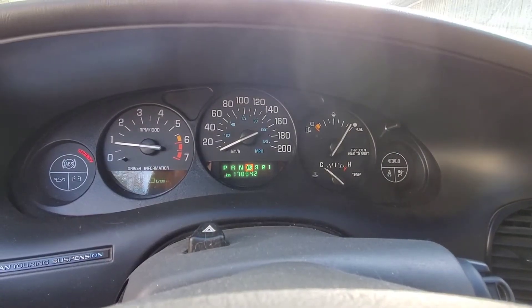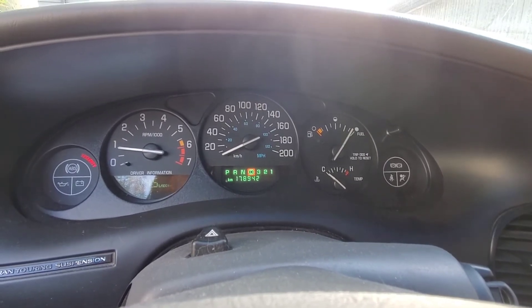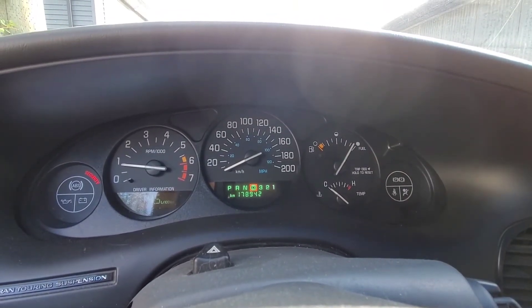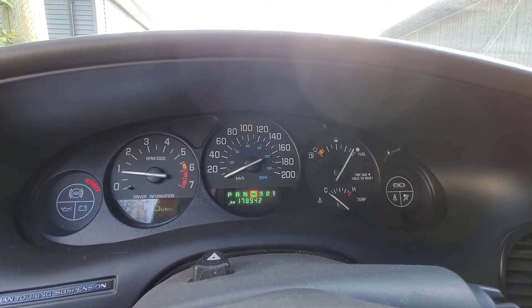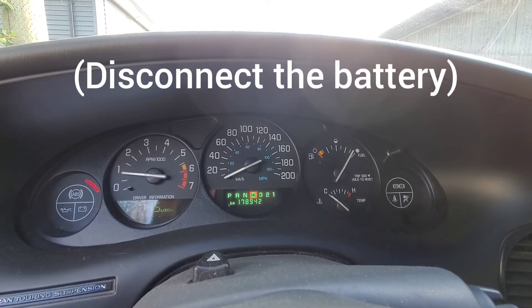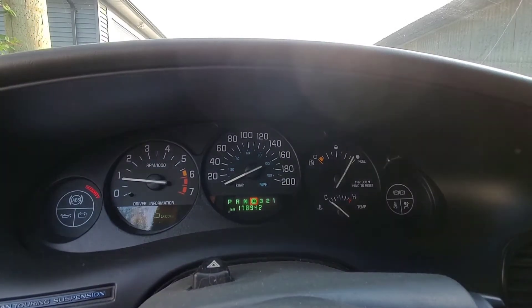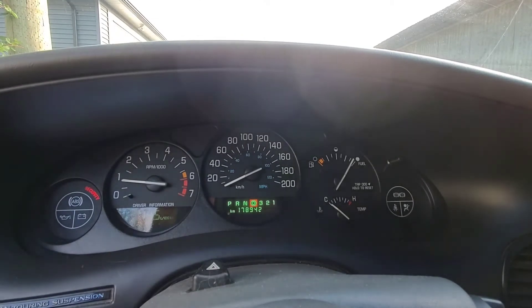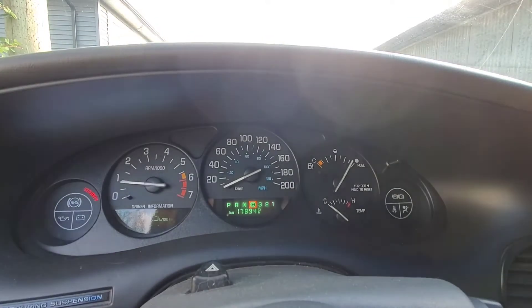We're going to take the car for a test drive. The key thing to keep in mind: make sure you delete the code so you don't have a light on the dash. There are two ways — use the scanner to delete the code, or unplug one of the battery leads. The thing about unplugging a lead is you can lock out your radio if you don't know the code, so be aware of that. Make sure the code is out of the system so it won't affect the car's performance during your test drive.